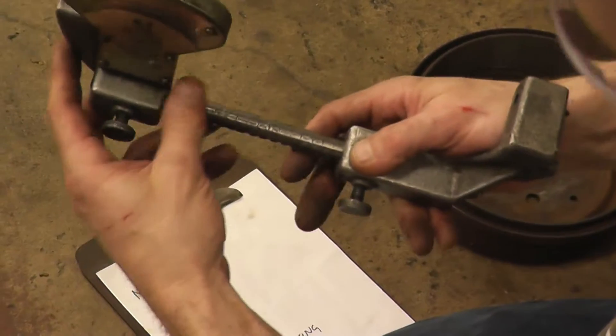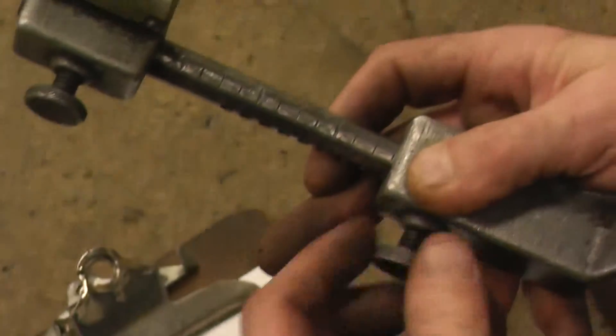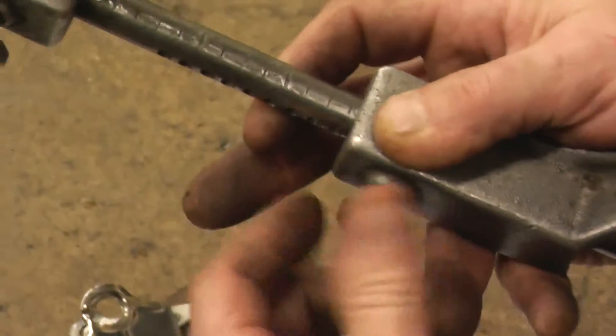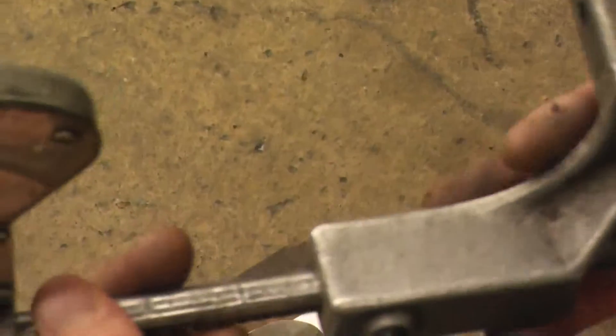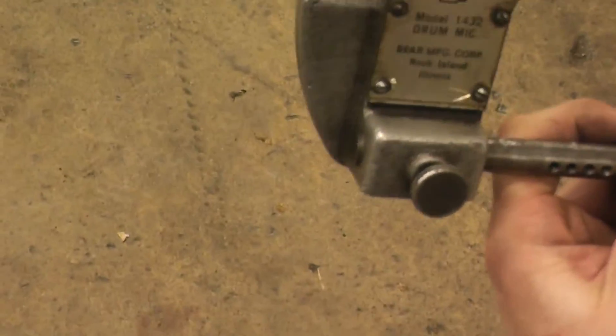We want 9.750 because it's the number just below our maximum of 9.980. So we're going to set that up right now. You will actually see how this will line up itself — it's now in position. We can tighten it up. But before we get into measuring anything, we've got to make sure that nobody before us has moved this part.